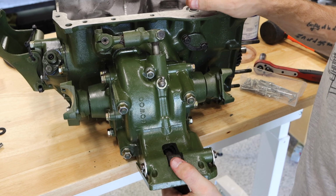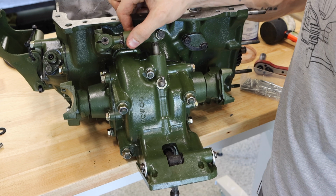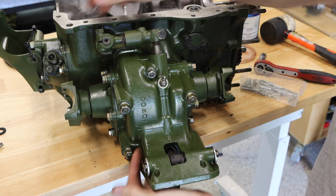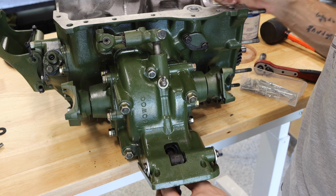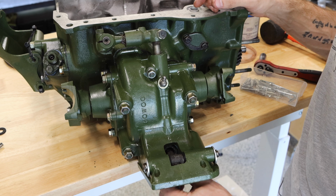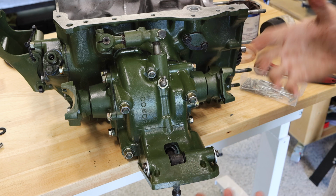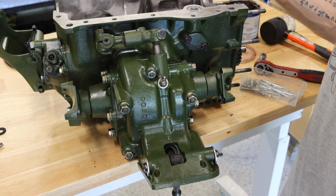A shifter ready to be used on your car. Now, it's kind of hard to select gears by hand. You probably won't be able to, and that's totally fine. But what you will probably be able to do is, if you have your shifter assembly, hook it up if you really want to test it out and test all of the shifting linkages. But in reality, if you're trying to shift it into gear up at the top with like a pry bar, it's pretty much the same thing.